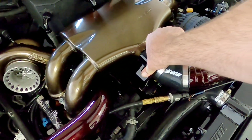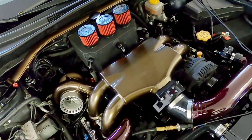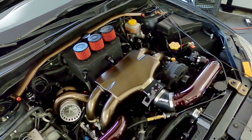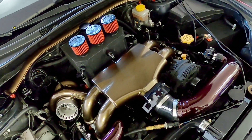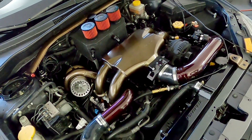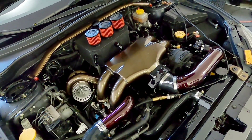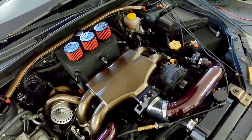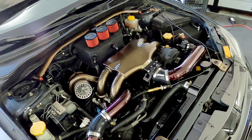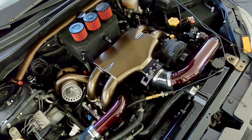Boomba throttle body, so big throttle body. Like I said before, it's a PR Racing ProDrag motor, which is not a closed deck engine — contrary to what everyone would tell you you need. We make well over 1,200 horsepower on these open or semi-open deck motors. They're sleeved with a custom step deck, the heads are O-ringed, and we don't use a fire lock on the block itself — just an O-ring on the head and a stepped sleeve — and that gives us all the sealing power we need. We use half inch studs, not the 14 millimeters that some other people use. We've never actually had a head gasket failure, and I'm not even going to knock on wood. This system has been proven to seal at as much boost as we can get one of these cars to make. We have more of a limit with connecting rods turning into question marks than head gaskets getting blown out.